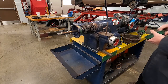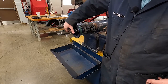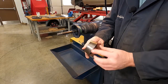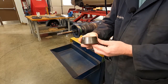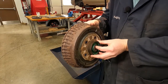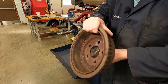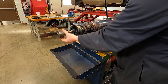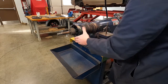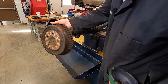Put the first cup on and put the spring on. This is the taper, or I call it the cone. The cone needs to fit in the drum and you should have part of the cone sticking out. Put the cone on. Make sure the surfaces of the cups are clean and the arbor is clean, then put the drum on.